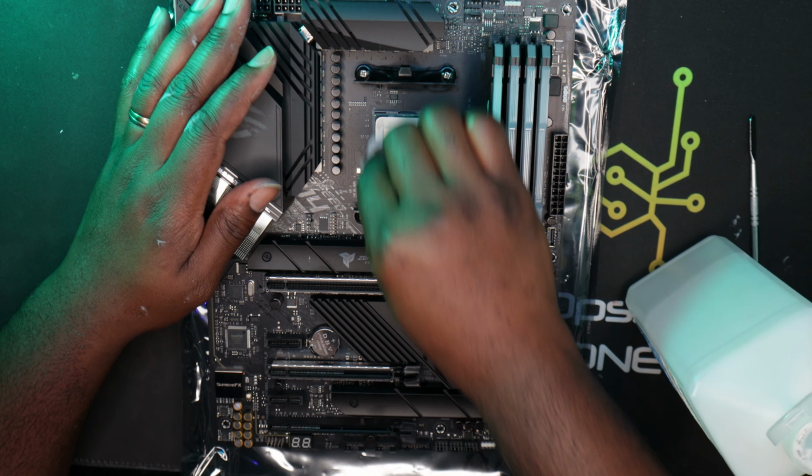While the camera was overheating, I took some time to rewire back the motherboard with the corresponding wires in the bottom. The HD audio, USB ports, fans, and RGB and power. With one new addition, that will be the temperature probe, which I will be mounting somewhere in the case. I have a splitter right here that is communicating through the motherboard to the rear exhaust fan. Connecting back the 24 pin.